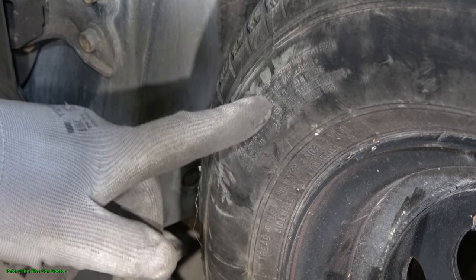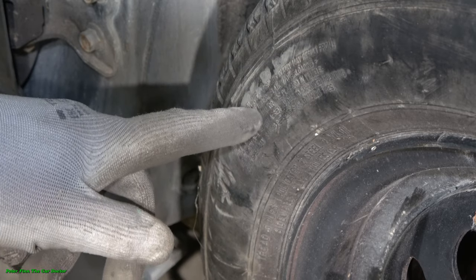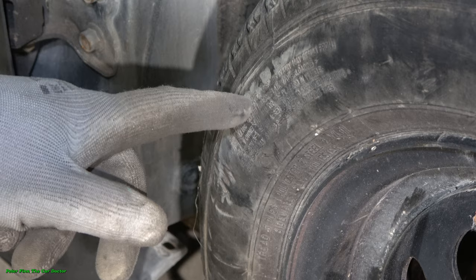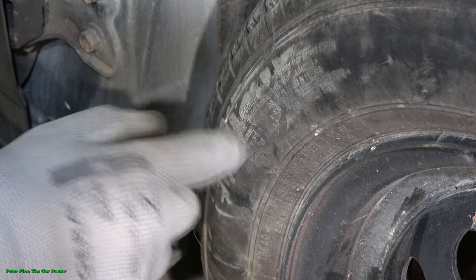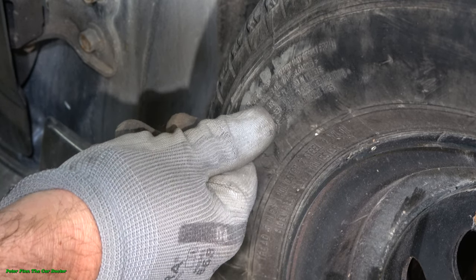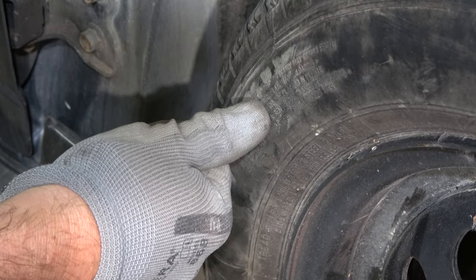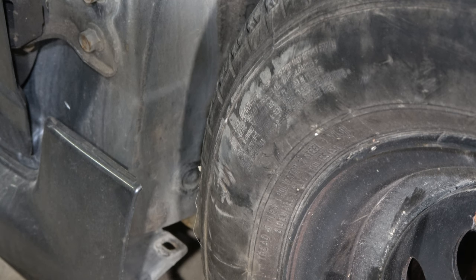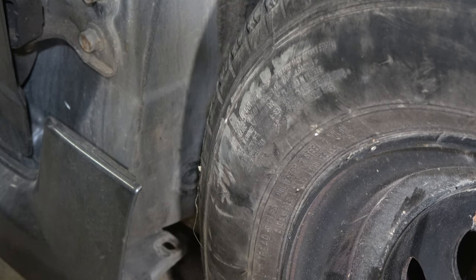And in that wheel and tire, there is 2.4 bar pressure inside. And this is just okay for this Toyota Corolla car. And look, my thumb goes only a little bit, a couple of millimeters. And this is the finger test, the final one.